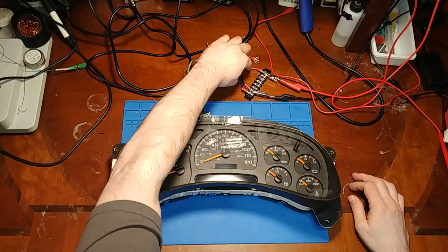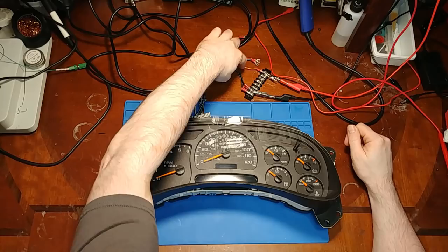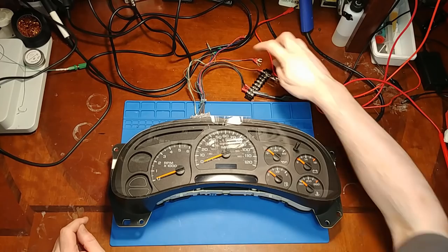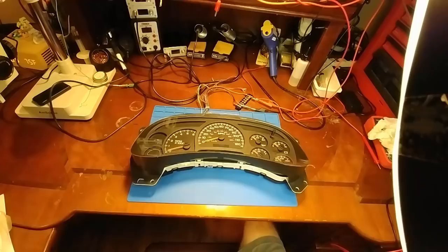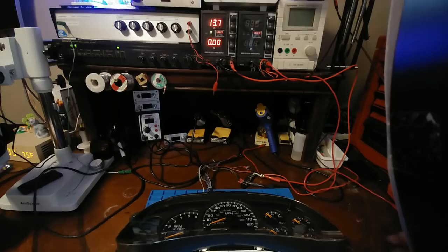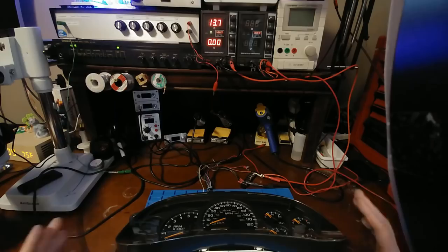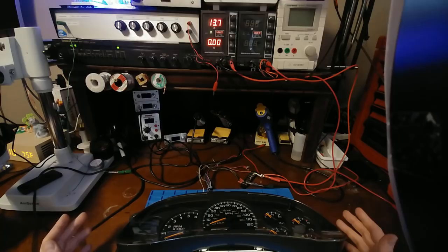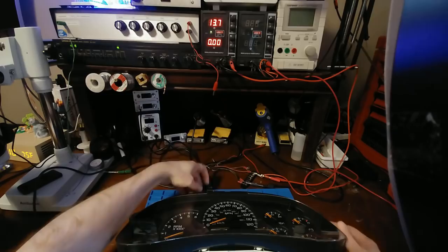What I've done is I've already disconnected all power wires except the constant battery 12-volt wire. So when the key is off and out, this is the only wire that sees power — this is the only wire where battery drain can come from. We're going to monitor the current on this wire. I'm going to change over to wide view so we can see the power supply. We should see about a 0.4 amp draw for about 24 seconds if it's working correctly. After about 24 seconds the power draw will go down to pretty much zero and the cluster will be in what I call sleep mode.